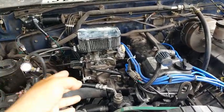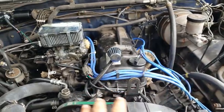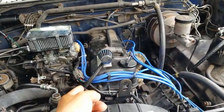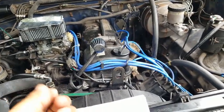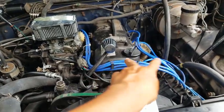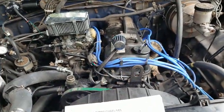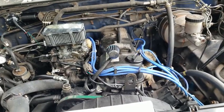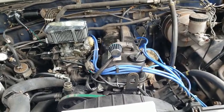But the reason I was doing that was, again, because of the bad spark. When I pulled all the spark plugs out, there was so much carbon buildup in them. It was horrible, and they were actually new. I had just replaced them; they were new, and there was an abnormal amount of black smoke in the tailpipe. I mean, it was bad. It was pretty bad.